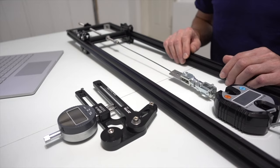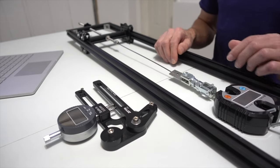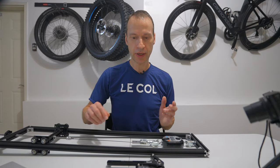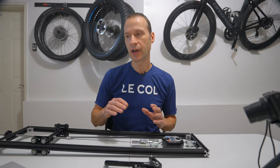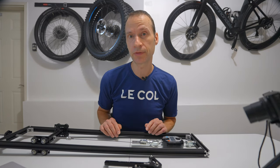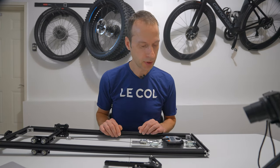So let me now show you how this thing works. Essentially what I have here is a crane scale attached to a device that holds a spoke, and a part up here with a knob that either tightens or loosens the force on the spoke. What I can do using this Zetto spoke tension meter — or any digital spoke tension meter — is measure the deflection of the spoke at different kilograms of force. I use a spreadsheet to track my spoke tensions, recording that deflection starting at a low amount of say 75 kilograms of force going up to like 130 to 140.